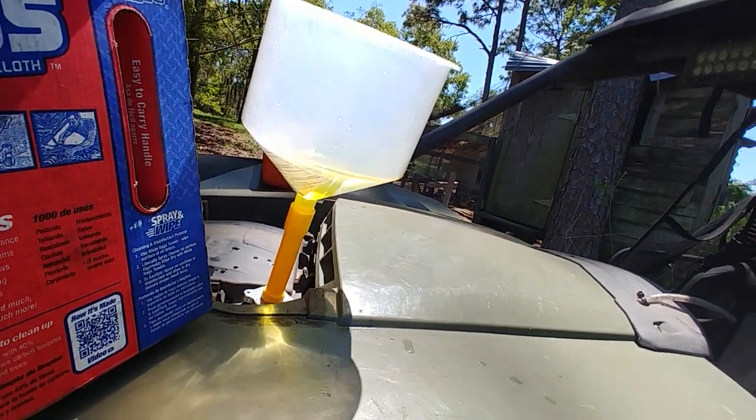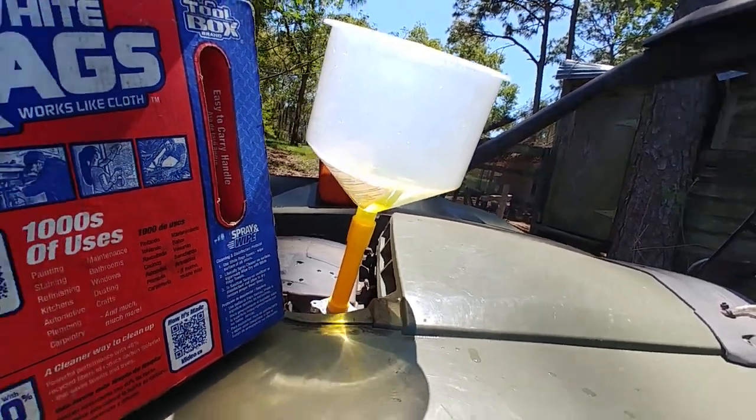Just to get any more stuff out. I've done this about three times now. What happens is it'll heat up, I'll shut it off, and then the machine burps and takes more coolant. Then I let it cool down, start it, and do it all over again.